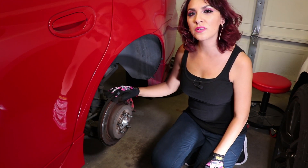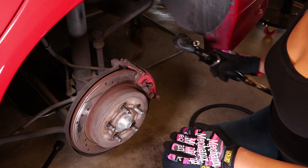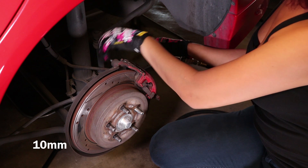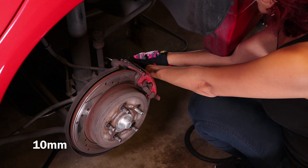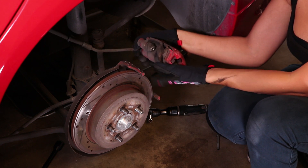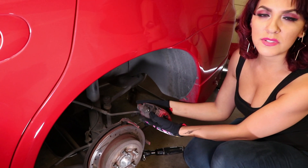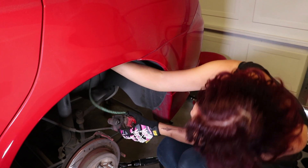What we're going to do is replace the rotors that are not cross drilled and slotted, so that's why we let them go to waste. First I have to remove the two caliper bolts in order to remove the caliper. You don't want to just let it hang because this is where the brake fluid comes through, and if you just let it go you're going to mess the whole thing up. So what we do is put a hook and hook it up to the suspension as high as you can.